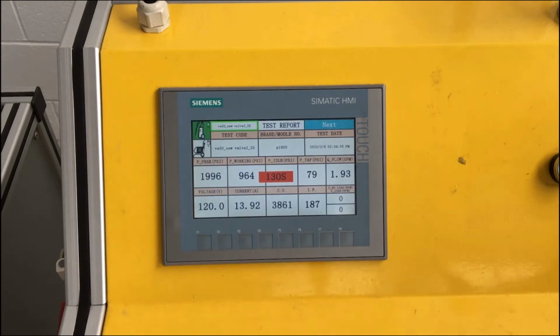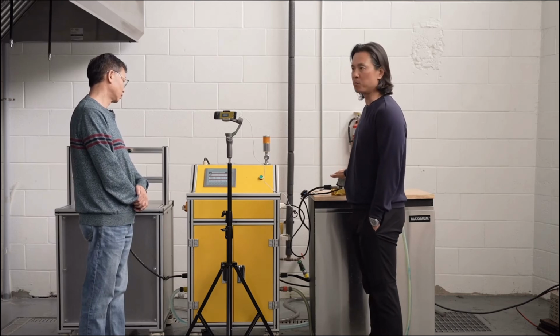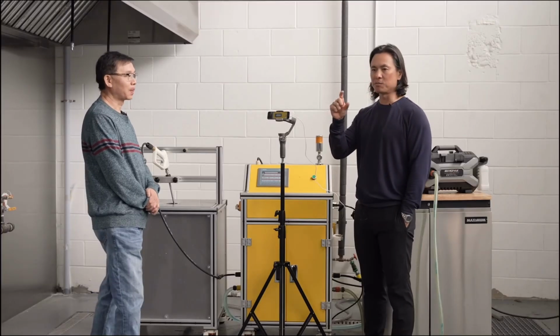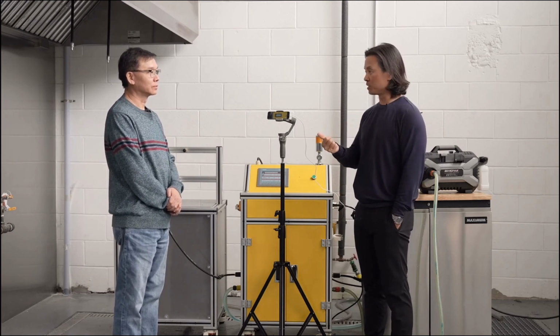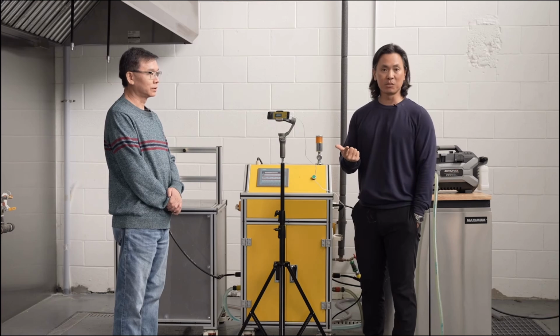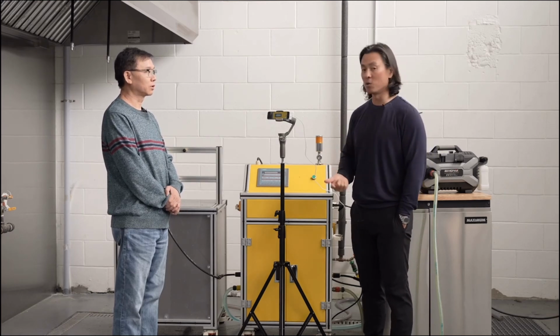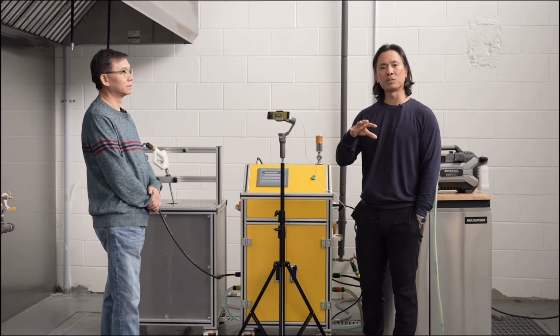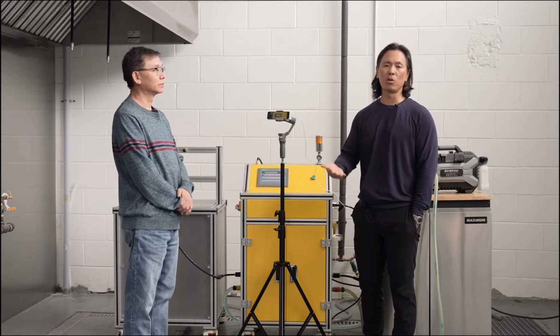And what that really does is it limits the amount of pressure that the pump will run up to. When you do have a more consistent auto cutoff valve, you're going to have a more durable machine. You're going to have less cycling when you're using the unit, with no cracking on the pump because the pump is never getting up to those high pressures. So it's going to help the quality of the machine.